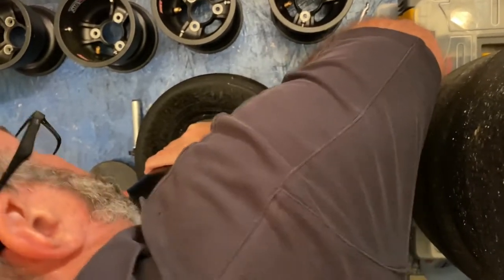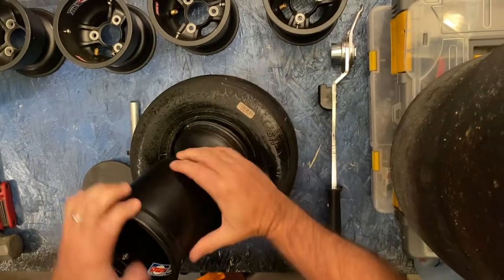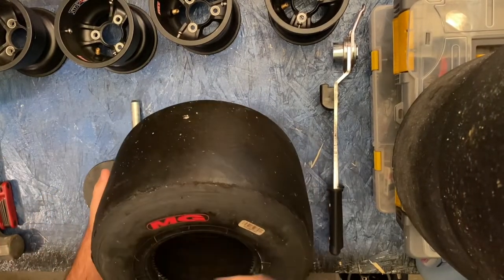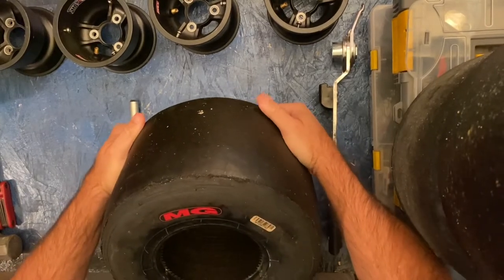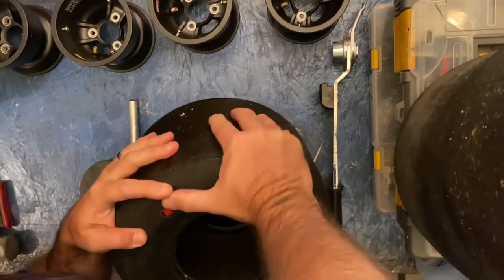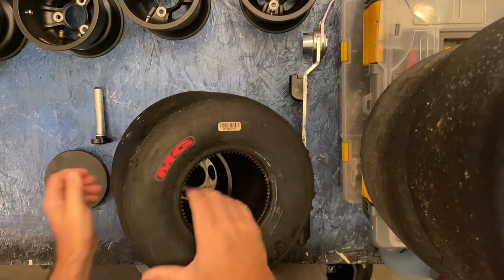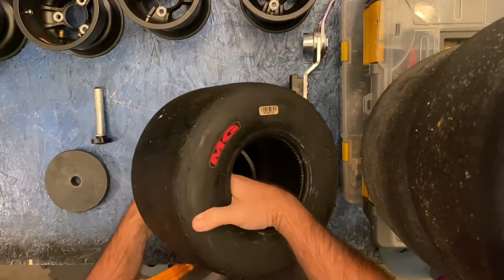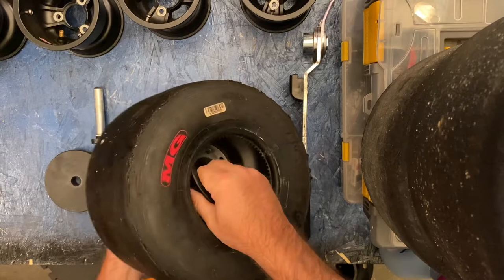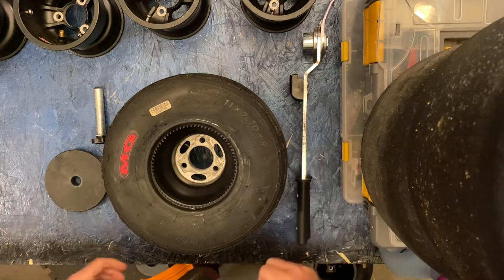I've got it in pretty good. I'm going to try to push it all the way through — sometimes I'll flip it upside down and pull on it. You can see it's most of the way through. I'll grab it up here, hold it super stiff, and just push on it — it should push past just like that. On a softer tire you can squeeze it, grab it, and pull down. Just make sure you don't smash your hands into the ground when it finally goes through. That was the hardest part — this next part is the easiest.